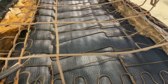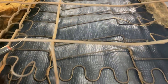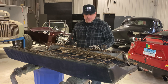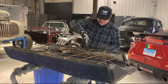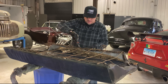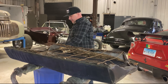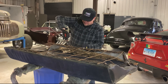The metal doesn't seem to be rusted. Obviously some mice were in there, and it's been reupholstered because they didn't come from the factory with an alligator print material on the inside. I'm going to start taking off the hog rings. All I do is grab it and twist, pop it off — I don't snip it. If you snip it you get sharp pieces of metal all over the place that could fall into the seat, onto the table, and scratch or rip the material. I take the whole thing off and put them straight into the garbage.